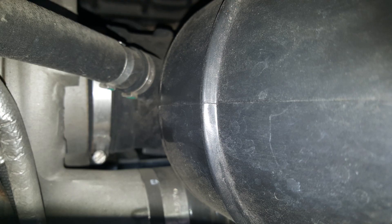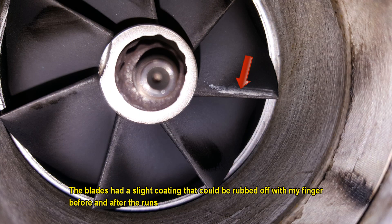One other consideration if you're going to run without the entire assembly — probably a small one. I watched a video about a Duramax, which has a similar configuration with the crankcase ventilator coming in right at the front of the turbo compressor blades. When they changed the inlet configuration, it started sucking more oil out of the engine. I don't think it's an issue here — I actually checked for it after my four runs without the baffle and didn't see anything significant. But it's worth monitoring long-term to make sure you're not getting excessive oil draw or excessive vacuum.